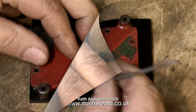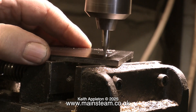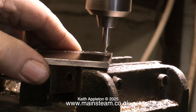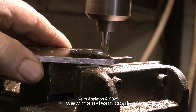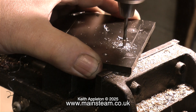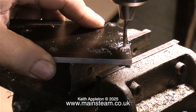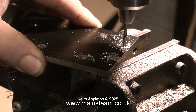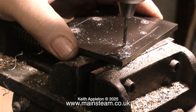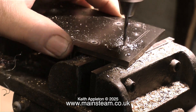So here you see me drawing around the component. After marking all the positions of the bolt holes, it's over to the drilling machine to drill the holes. I'm using a centre drill, and from experience I can actually see a spot on a piece of metal and put the centre drill where I need it to be. If you're unsure about drilling the holes this way, a better method is possibly to use a magnifying glass and use a centre punch, and punch the holes manually before putting the drill near them. As you see on the metal plate as I'm drilling it, I have not yet marked out the position of the other two lugs. So all I did was turn over the component, which gave me an extra two lugs to play with, and I drew round those and marked out the centres of the holes. This in reality was not a brilliant idea, because to my surprise the original positions of these lugs were not 100% accurate. I should have done it a little bit more carefully, if I'm perfectly honest. But by doing a bit of careful reprofiling of the part, it worked out fine in the end.